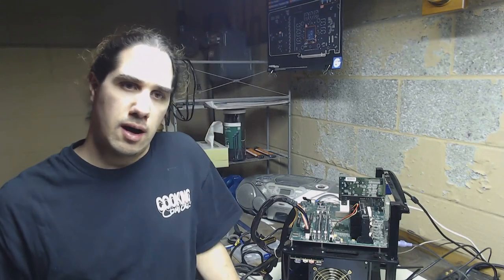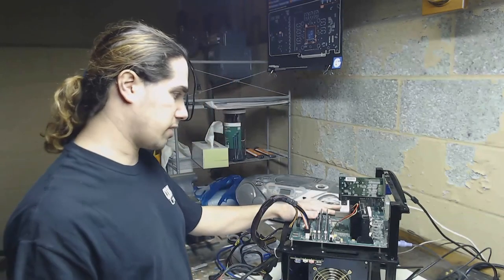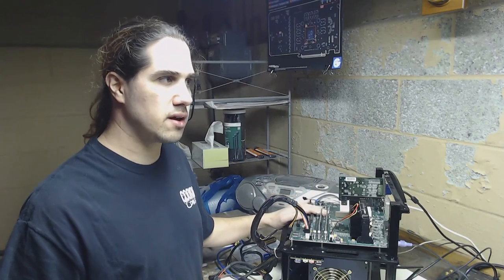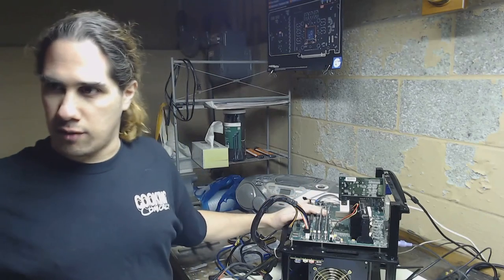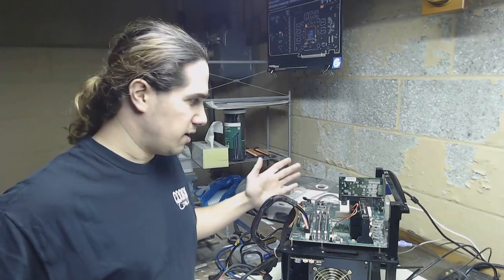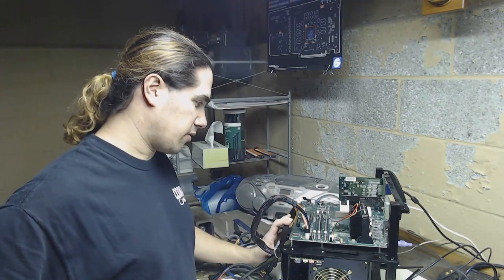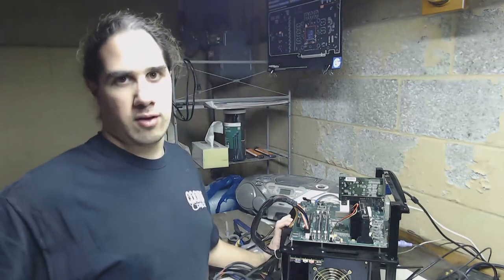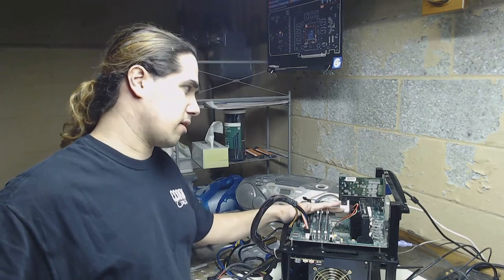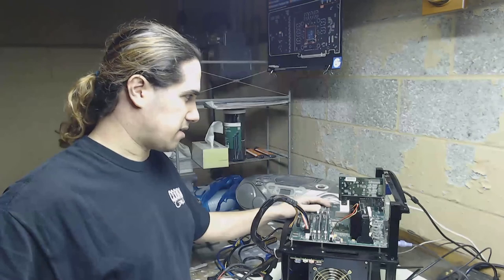So I wonder if I can try, like I said, a PCI controller that can do IDE and floppy and see if that'll bypass the one built in and if that would work. Hopefully the BIOS would be able to see that. I don't need something like XT-IDE because this is way past needing anything like that. But on a system like this, you wouldn't think you'd need a separate IDE controller either, so who knows. Again, I want to see if I can get a proper AGP card, because using a PCI video card in a system like this is kind of silly.